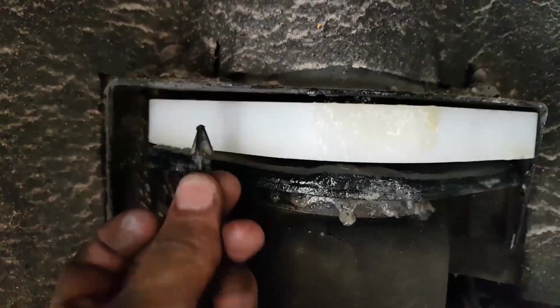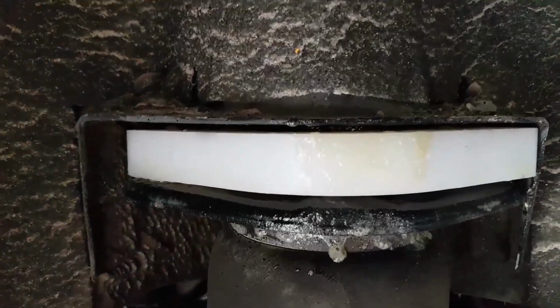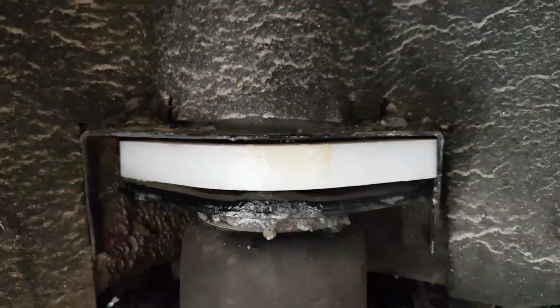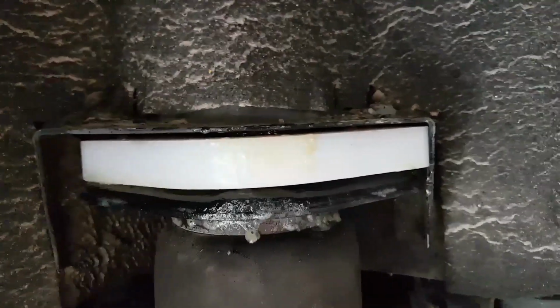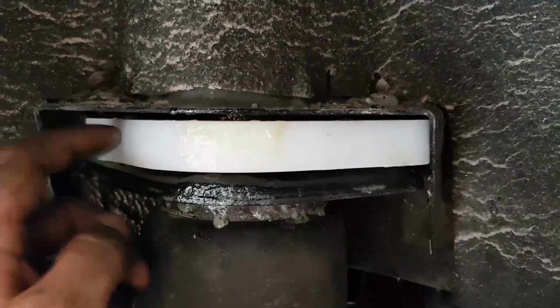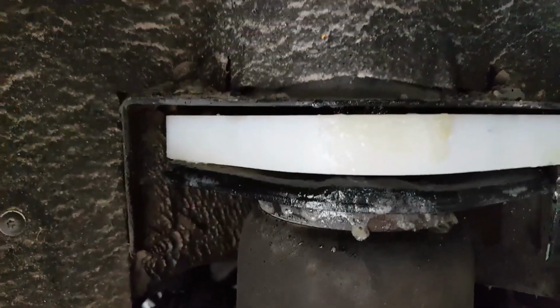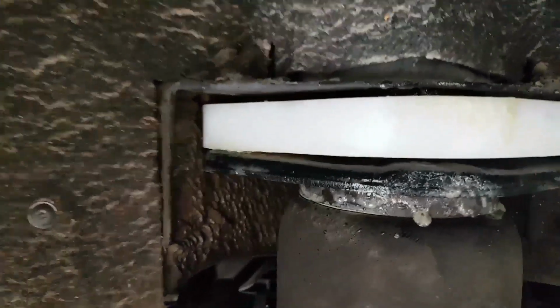These little pins, there was one about here and one there, located the stock steel flange onto the body, and they're just there for fast assembly on an assembly line where they're doing a car a minute type of thing. So I didn't want to compromise the strength of this spacer, because those little locating pins are close to the edge, so I did not include those.